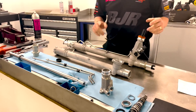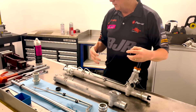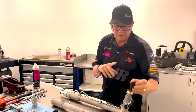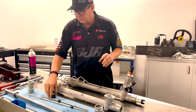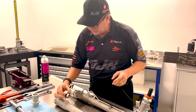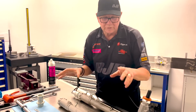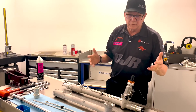One of the real issues is the seal — with the pressure it gets under and the amount we need to steer these cars, we're blowing these seals out. That was one of the problems we had with Andre's car. Andre's car also had another seal issue which I don't think anyone else has had — this little seal here presses in and the rack bar goes through it, and that was damaged. Those were the two separate things that happened to us at Sydney Motorsport Park, prior to and during race one.